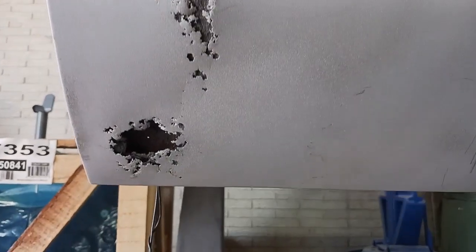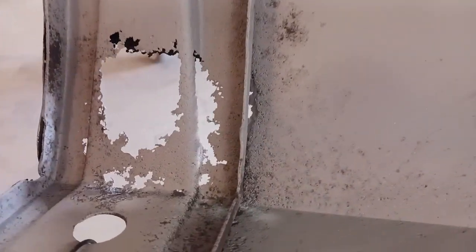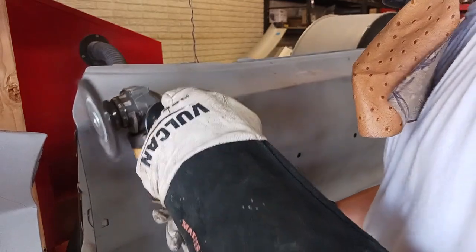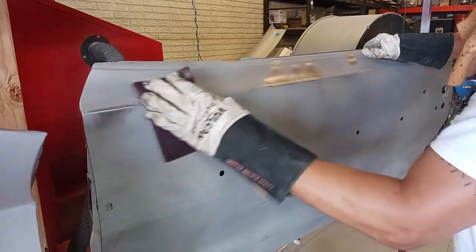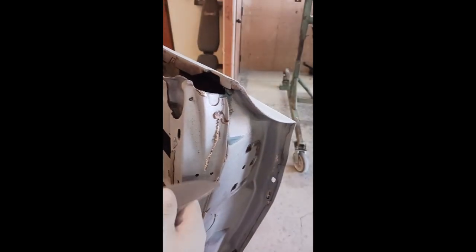It's pretty much average damage — lower part of the fenders. The driver's side is a little bit more than the passenger side. It's affecting the outer skin of the fender and the inner braces and brackets. This is another important thing to keep in mind: this oxidation comes from touching the bare steel or media-blasted steel — maybe my arm touched it — and it starts oxidizing. So we want to redress that and not go over it with the epoxy primer.